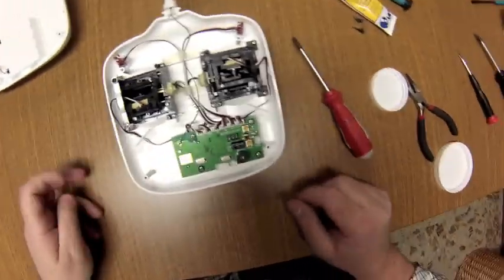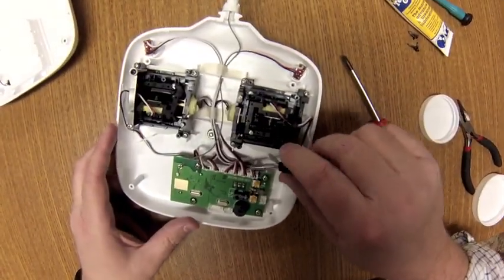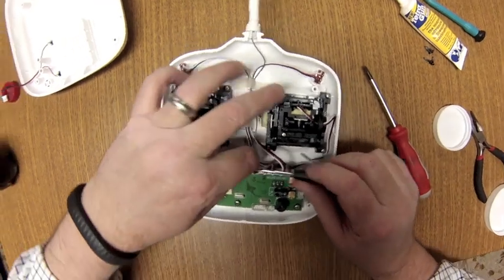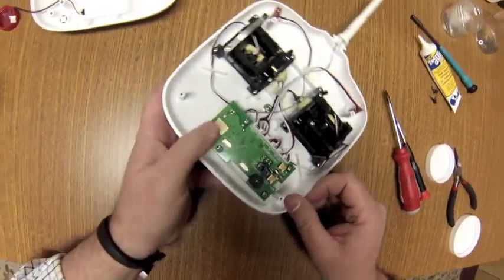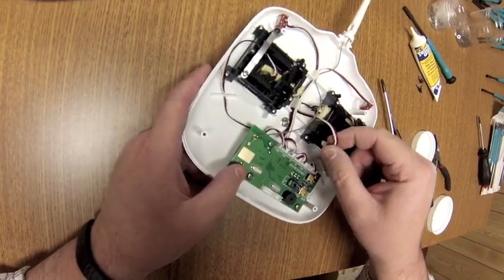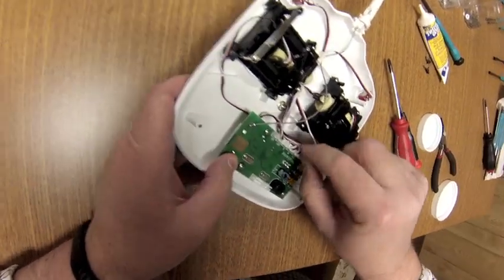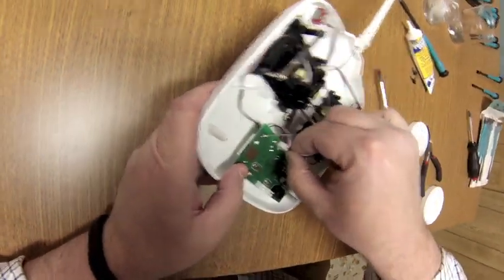So the last thing to do is to change over two of our wires here, and we don't have to do anything else. We don't have to do any servo reversing, anything like that whatsoever. So what we're going to do, it's the second one from each end. We just have to switch places. So very, very carefully pull those out and switch them. Plug them in very carefully. There and here. Make sure they're seated.